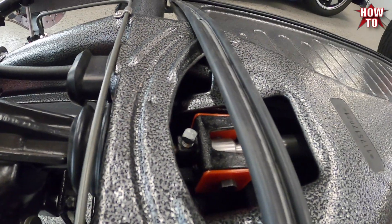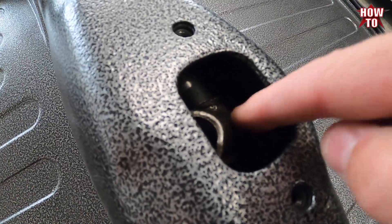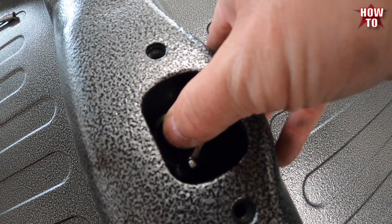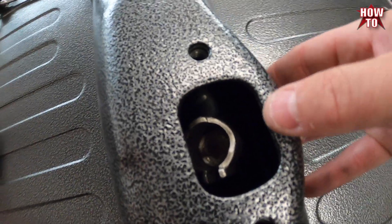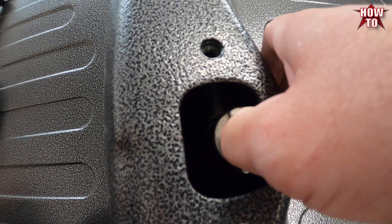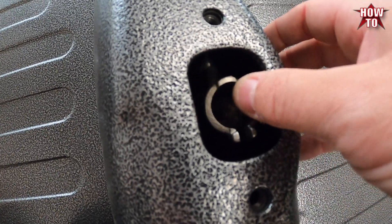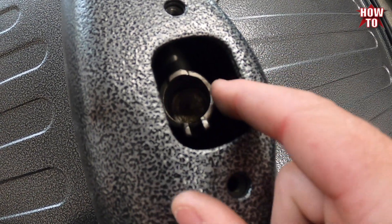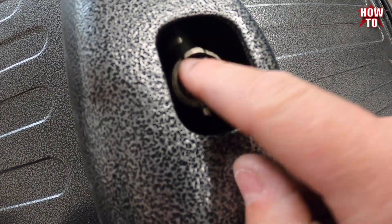Square drive socket. So I'm doing this because I want to show you that the hockey stick is locked in place. And you can see that the shift linkage cup is not in the right location, but we slipped the tube onto this so now we can just grab this and twist it, and we can look at our gate — left to right. See, that's a little too deep over here. So we'll turn it this way so it's right to the edge there. That is ideal for your gate so you don't have to start trimming on this. Get it right where it needs to be, and it's in the center of the hole.